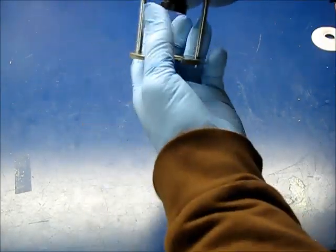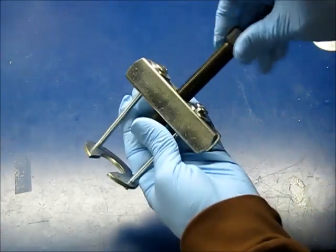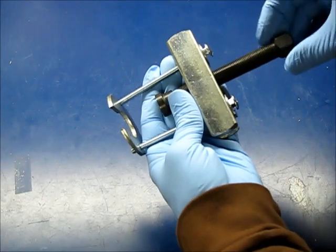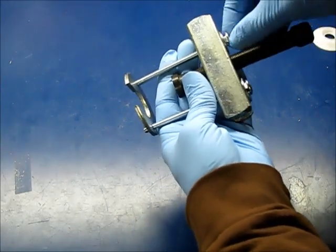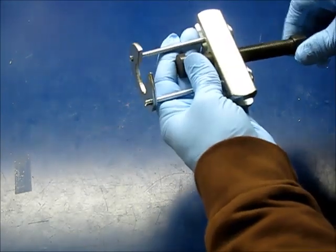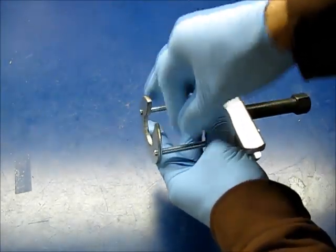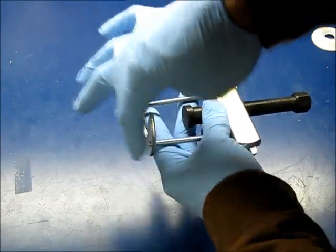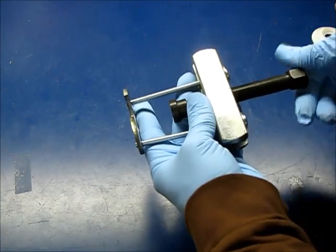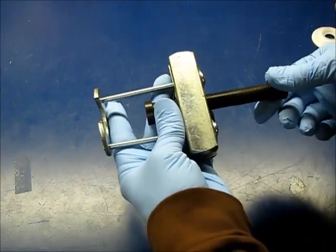As you can see now, as I turn my puller in, it's going to force through the hole I drilled on the top of the wiper arm. It's going to force it out of there. I'm just going to use the tapped holes and hoping those are going to be strong enough. Otherwise I could stick a little bolt on the little nut on the end here. But I thought I'd tap it, see if we can pull this stubborn arm off.